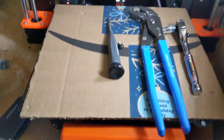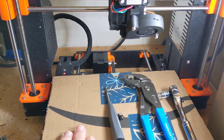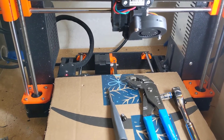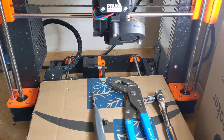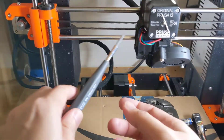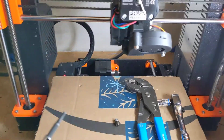I've unloaded it. I have a cardboard sheet on here — this is nice because I can keep the bed warm for my next print, but also not burn my hand while I'm working on it. Cutting out a nice custom piece of cardboard is very helpful for nozzle swaps and printer maintenance in general. It also keeps the gunk off the printer bed, which is nice.